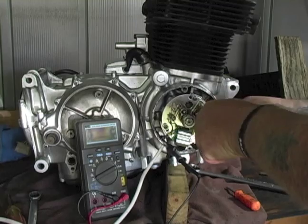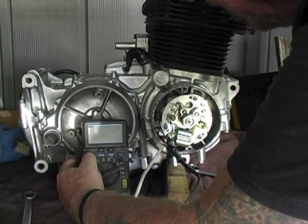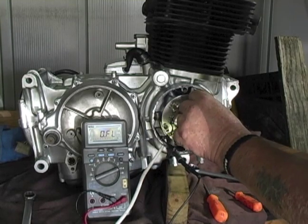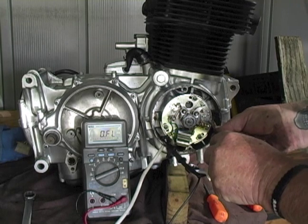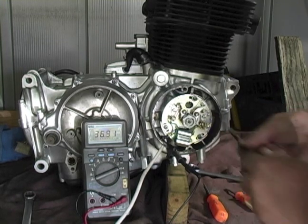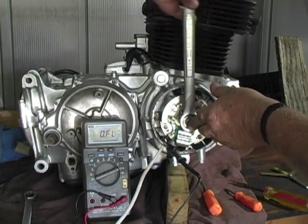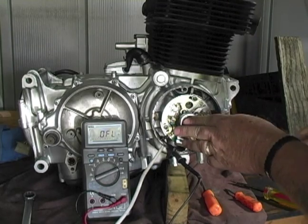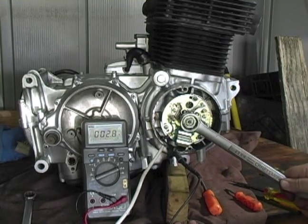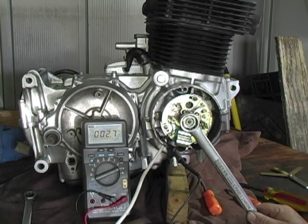We still want tension on them as we make this adjustment. Double check — open as it closes. So now we've got to get this to turn to where it's going to just shut off. Move it very slightly — right about in there. Let's snug that down again. And one more time, all the way around to the mark. There's the 2-3. Very slowly now, coming up on the F, watching the meter.